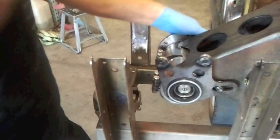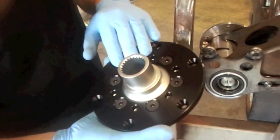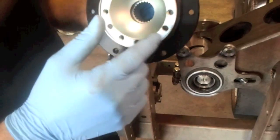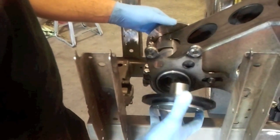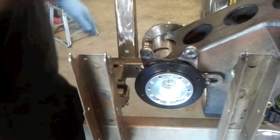On this job we're installing the inboard brakes, so I've already mounted the rotor hub on it. If you're not going to do the inboard brakes, then this would just be the small hub. Since we're going to do that, it's already bolted to the back. We're going to install this hub next — so it's all the way in, pretty easy.